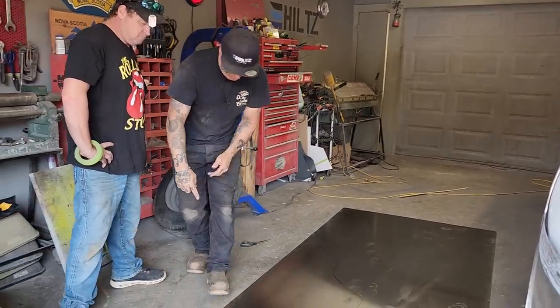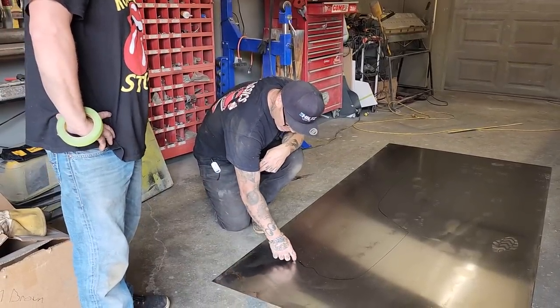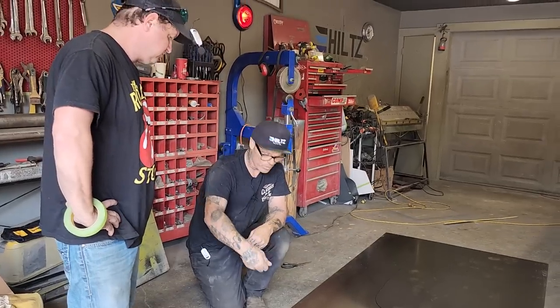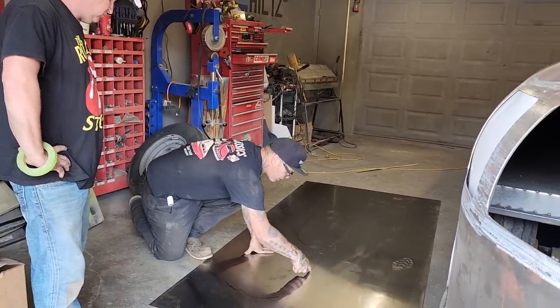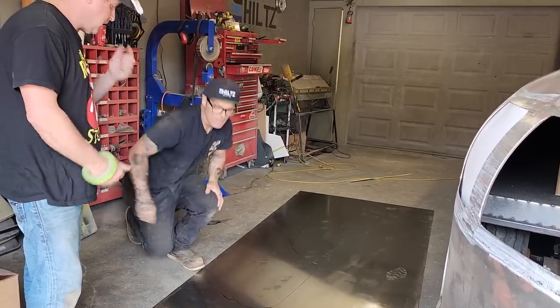And this sort of stuff, if you have to cut, cut it straight this way, and then cut it straight this way to get it to come together. Just do straight, and then we can flapper wheel it to where it needs to be. That can be cut. You can just cut this one off right along here and go straight along that if you want to. Sure. Then we can cut this off after as we make it smaller.